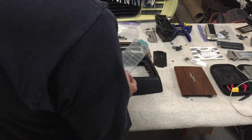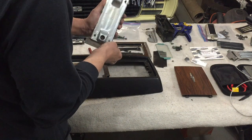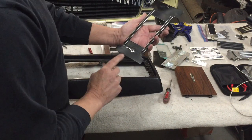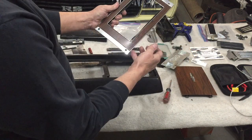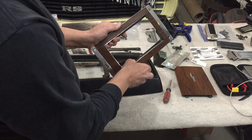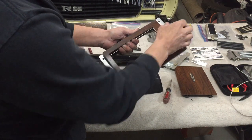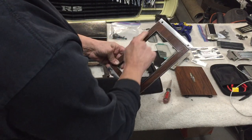I have to pry these off — these threaded areas spread the material just enough that it doesn't want to come off. I'll be able to clean that up, then sand and get all this prepped and ready to paint. I'll be able to make this look brand new again. It's in excellent shape. It's probably going to be easiest when repairing this piece to take it completely off if I can get it off without bending it. Otherwise, it might be best to just get some epoxy around the backside of it and re-glue that down. It feels like it's got a good strong bond, so I'll just get some adhesive to the backside of that and not risk bending it and cracking that surface.